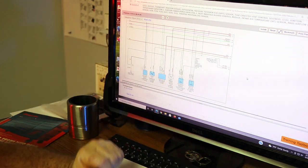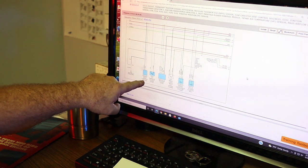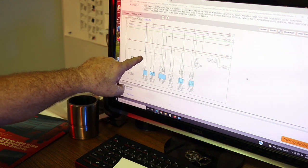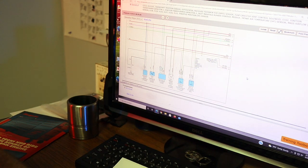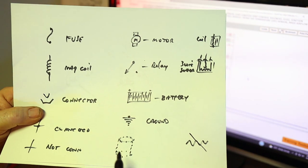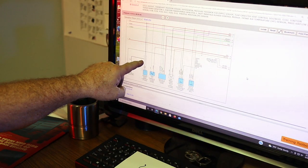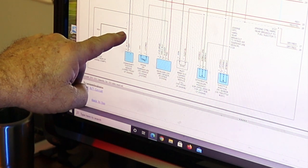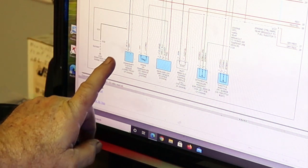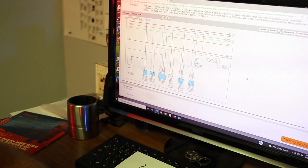Some sensors have multi-step ones, but we don't need to go into all that. The crankshaft position sensor is a very sensitive circuit, so it has a little barrel or drum symbol with dots around it — that's an insulated circuit to avoid radio interference. It means the wire is a twisted pair, probably insulated, so it can't pick up radio interference that would make the car run bad or shut off.